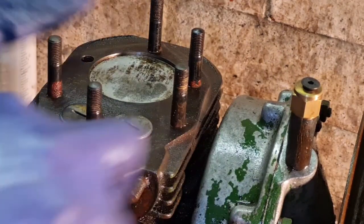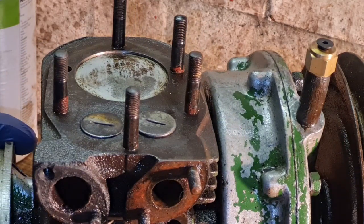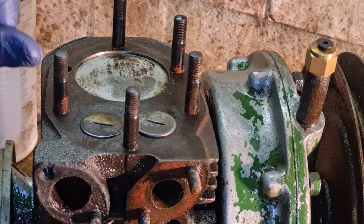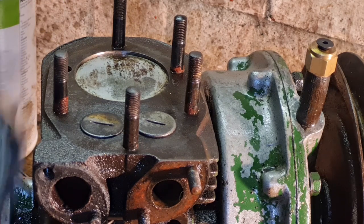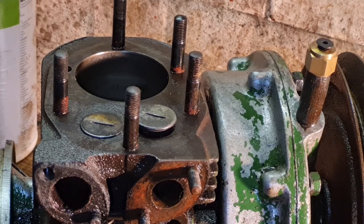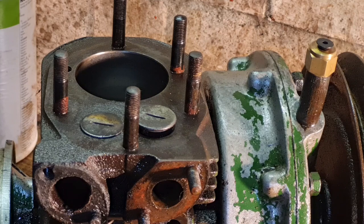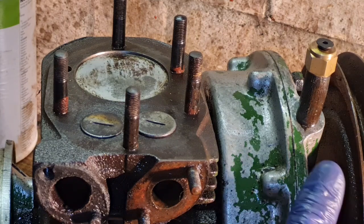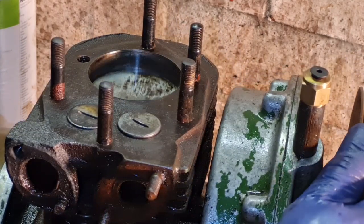And if you don't know the reason for that, it's simply because the exhaust side runs hotter than the inlet side, so there's a little bit more expansion, so you have a slightly bigger gap on your exhaust valve, so as the metal expands and closes the gap up a little, it comes right. If you had too small a gap when the engine was cold, when it was hot and that expanded, you could well have a valve which isn't fully closing, losing compression. So always make sure